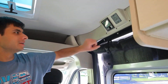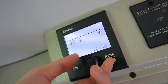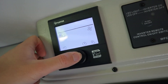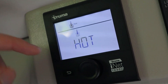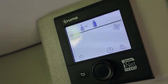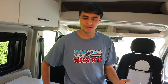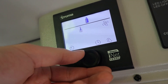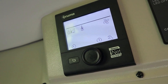At the entrance we have our water heater. To heat up your water, you're going to push this dial right here — the display will light up. As you turn this clockwise, it'll go from the RV to the thermostat being selected. Press that, and right now it says off. Turn to the right clockwise twice over to hot, then push it down to select it. Now the thermostat says hot — it is using propane to heat up the water and will take up to 15 minutes. You only want to have it on if you're going to use hot water, otherwise it'll drain your propane. To turn it off, do the same in reverse — go back to the thermostat, turn counterclockwise twice back to off, and push it once more.